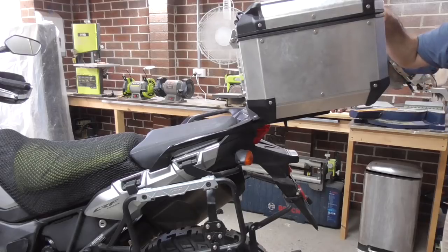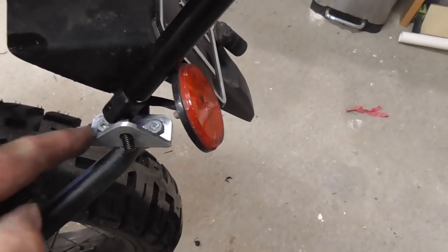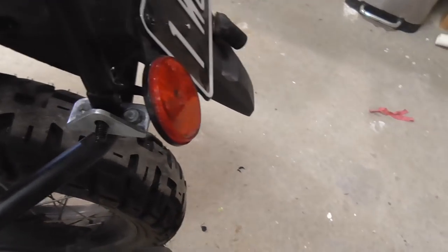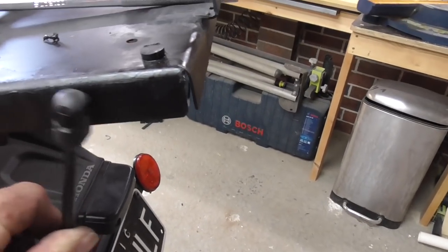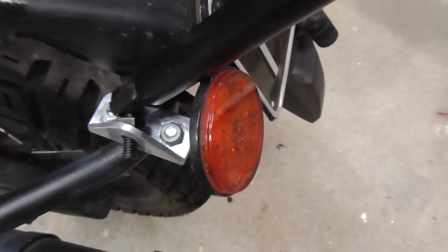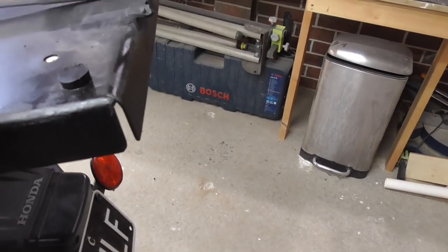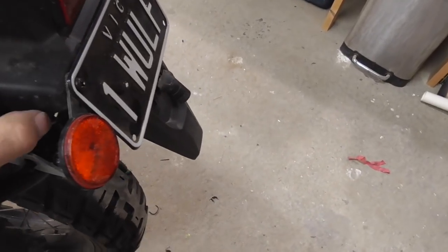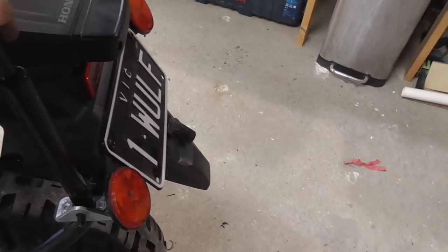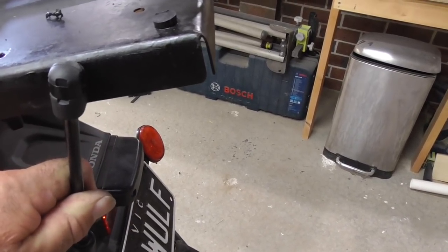These struts I bought are 300mm - you can get them in all different lengths. I've decided to position mine just behind the light so they're not on view from there. The bracket I'm going to put there - this will come somewhere here, I can drill the hole to put the stud in, which will take that side the same as the one down there. I want this just slightly under a little bit of pressure, nothing major. If 300mm didn't fit your bike, you could tilt the bracket to gain length, or go around to the side or the back.